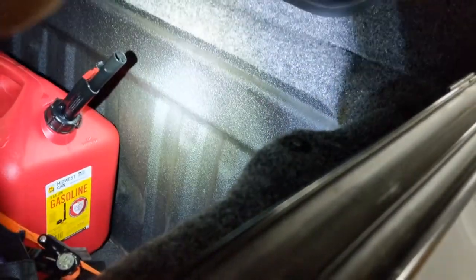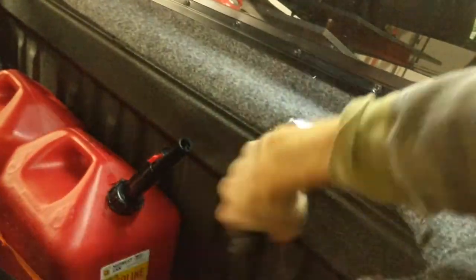I put my finger up under this area right here and was able to push that out so it overlaps. That should cure the water issue from this side. I see maybe a little place where water can get in from the corner, but if it continues I'll do something about it. The major issue was this weather stripping being tucked under instead of overlapping the lip. Thanks for watching everyone — have a great day, we'll see you later.